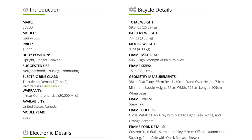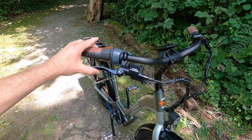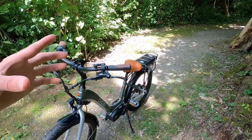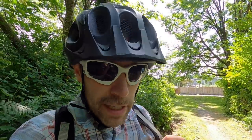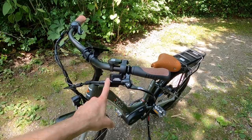When you've got that much weight going on, it's important to have good brakes. I like that they went with these Tektro Auriga e-comp — these are e-bike specific brakes. They've got the brake line and then an extra cable for motor inhibitors. So whenever you actuate these brakes, it not only sends a physical signal to grab that rotor — these are dual piston calipers by the way — but it's also sending a signal to the motor controller that says you need to shut off because this person wants to stop. That's about a 90 Newton meter rating on that motor — very, very capable. 500 watt nominal is what they say, up to about 600 watt peak. Tektro Auriga — three finger levers with adjustable reach, so you can bring these in for smaller hands.